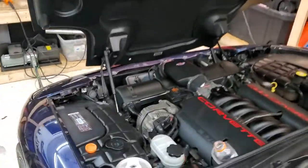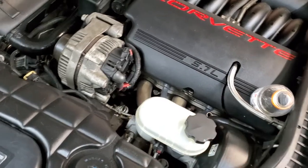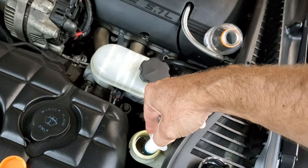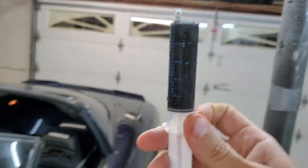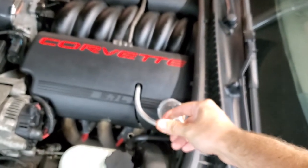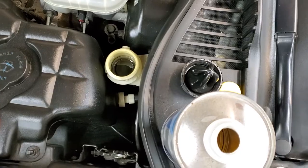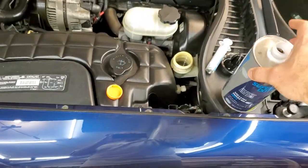Come back around and let's see how it looks now. Remember I just put fresh fluid in there so you'd think it would look at least kind of clear, but this clutch fluid only has maybe a thousand miles on it — and it's still black. You're going to do that until your fluid looks like the clean fluid that's in the bottle. See that color? That's the color you want, not black. When it finally comes out looking more like the clean fluid, you're done.